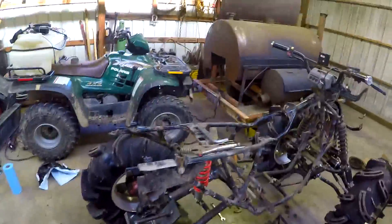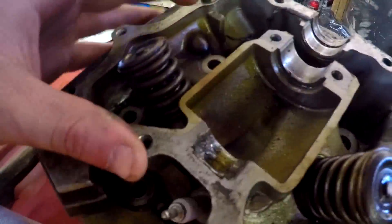Technically it's been going on for about a month, but this is like the fourth time that I've been over to mess with it. Originally we weren't going to touch the motor other than a gear reduction, but we found out that the head is completely trashed. This is why you don't use silicone on heads or valve covers anywhere on these motors — ever — because it destroys that cam journal. The cam is destroyed, the valve cover is destroyed, all that good stuff is destroyed.